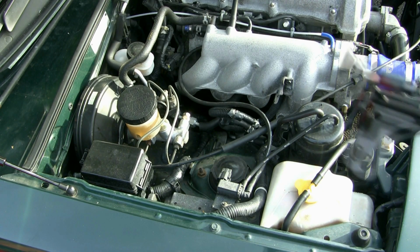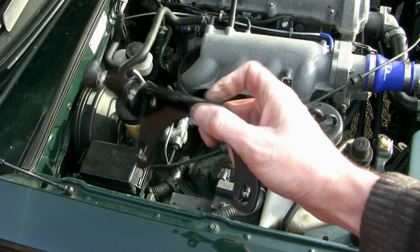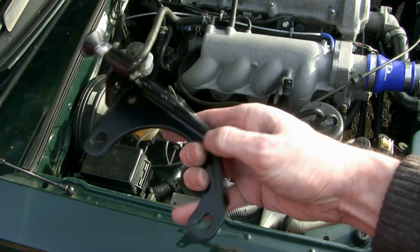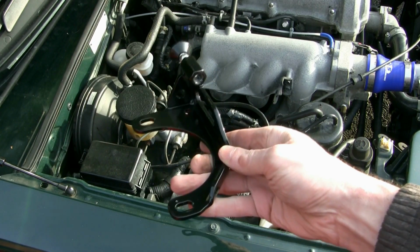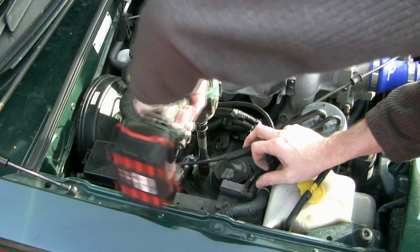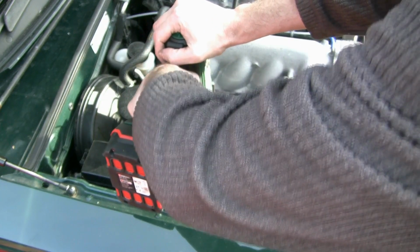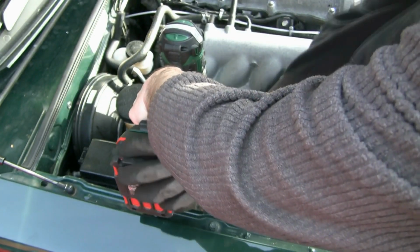It's a pretty simple device, bolts to the top of the turret, and it's got an adjustable stop which you basically wind up against the master cylinder. So two 14mm bolts secure the top of the turret. You need them off. They're what you're actually going to use to mount the brace in place.